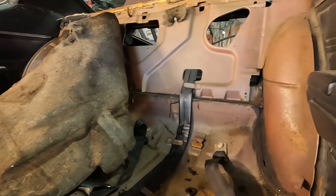Now we have full access. You might be able to cut the wires in the front, drag them through the back and fish them through — you don't necessarily need to do all this. But I am planning on getting it as close to original as possible so I don't have to sit and fish wires all the time. Hopefully I can get this all cleaned up again. It's going to require some new Kilmat down here, new carpet, new all that stuff too. So open up the can of worms, but let's get on with the taillight wiring.